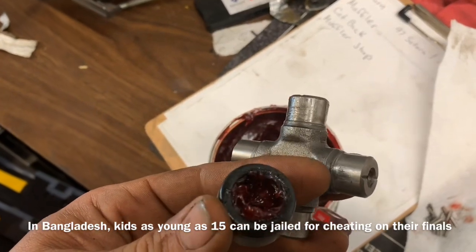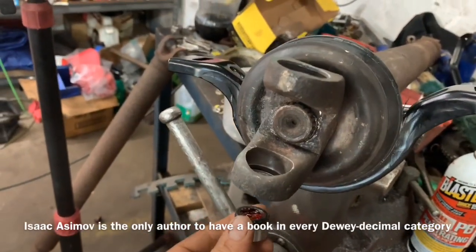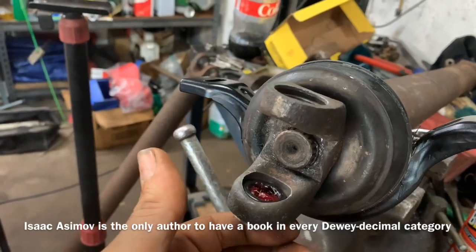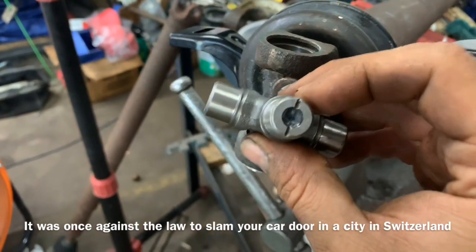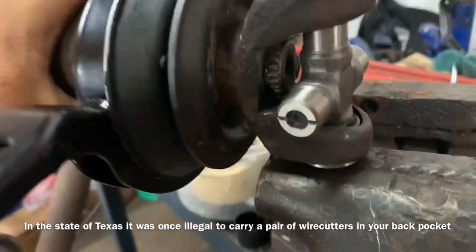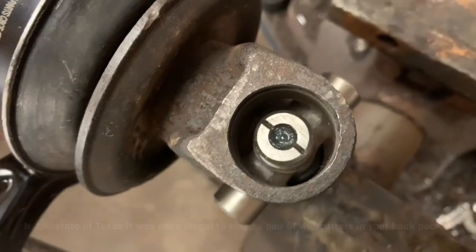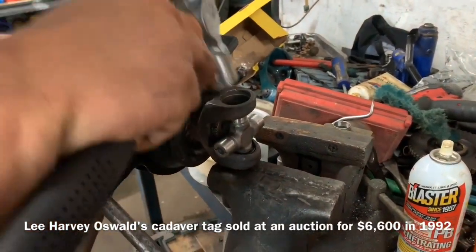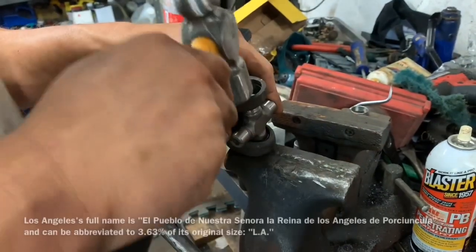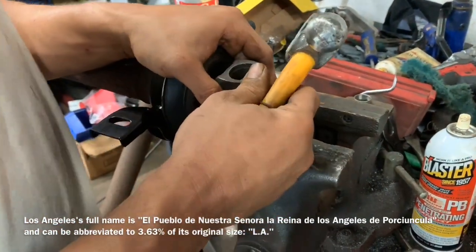Because these U-joints are cheap Chinese ones, I'm going to go ahead and put a little bit of grease inside there — that helps hold my bearings in better. Now with one hand I'm going to take and put my U-joint up inside there and slide it as far up as I can with my fingers so my bearings don't fall out. With my U-joint on a flat surface and the U-joint itself squared inside the hole, I'm going to strike it on the inside of the ear here to drive my U-joint down, holding on my U-joint as I push it up to not pop the bearings out of place — that helps get it seated while keeping it square.